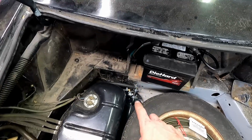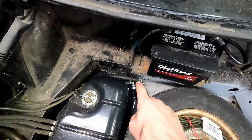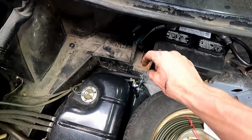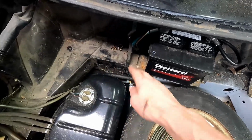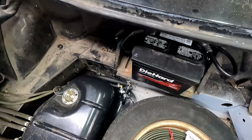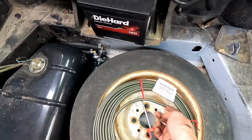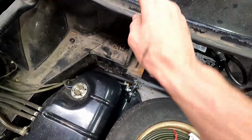I'm going to relieve the pressure out of the tank, and then I can start pulling these rubber lines off. And I'll just do little rubber joints on there to bring the metal to the metal and make this go away on both sides. So I'll show you the progress. Not going to be super exciting. Flaring the metal ends, putting it on there, rubber piece, clamp, keep on going.